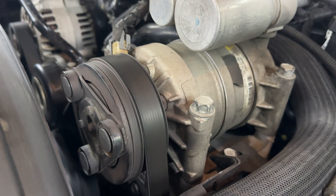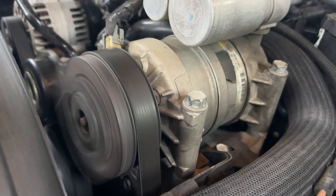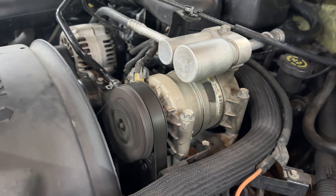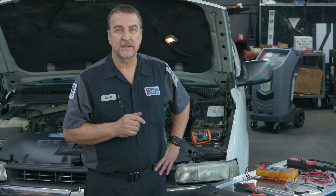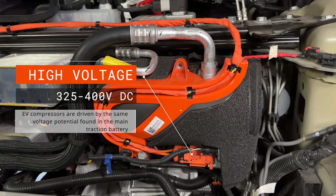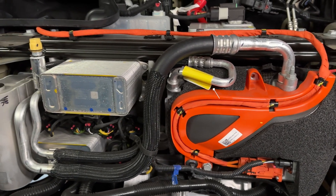In the past, a vehicle with AC would typically have a compressor mounted to the engine driven by a belt. When the AC is needed, the free-running pulley would simply be magnetically coupled to the compressor shaft via a clutch mechanism. With EVs, the compressor is typically driven by the same high-voltage potential found in the traction battery, which is anywhere from 325 to 400 volts DC.